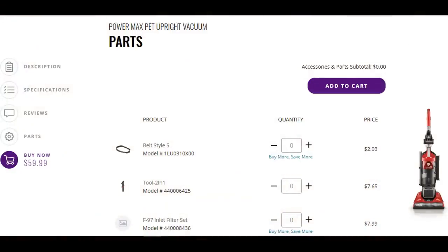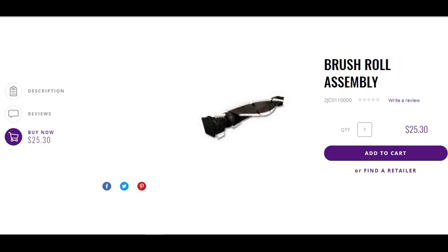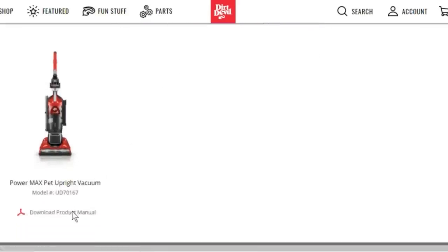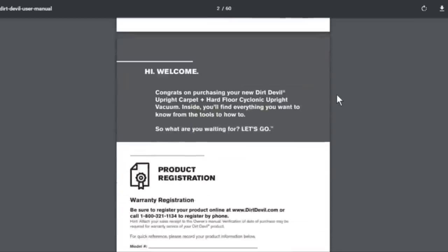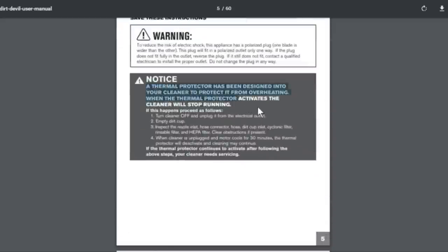It's been about a week or two now, and this thing is still vacuuming like a champ, so I don't foresee it having any more problems. For a cheap vacuum cleaner — you can get these for around $60 — I'm really surprised by how much support Dirt Devil gives this thing. If you go on their website, you can find belts and all of the filters you need, and even the brush roller, although at $25 plus $30–$40 shipping it becomes more economical just to replace the whole vacuum cleaner. It is nice to see they make the parts. You can also get the manual on their website, and if I'd had the manual, I probably would have noticed this thing has a thermal switch — so if the motor tries to overheat, that thermal switch will kick in and not allow that to happen.